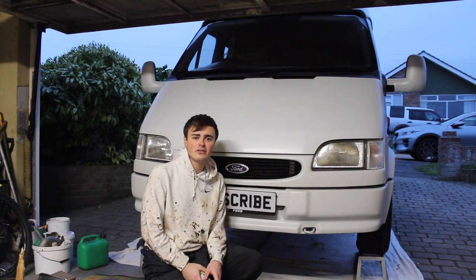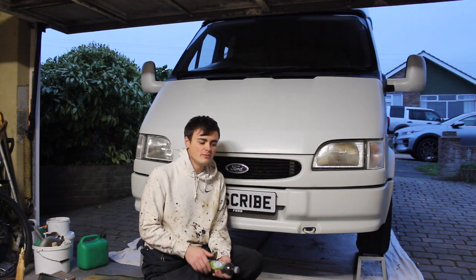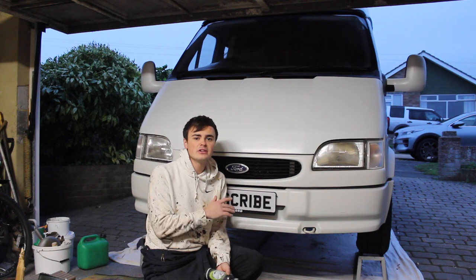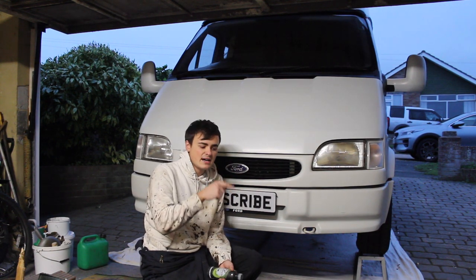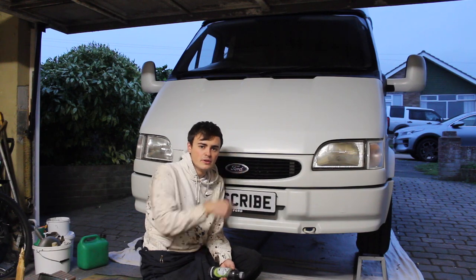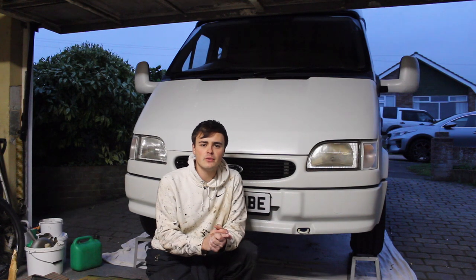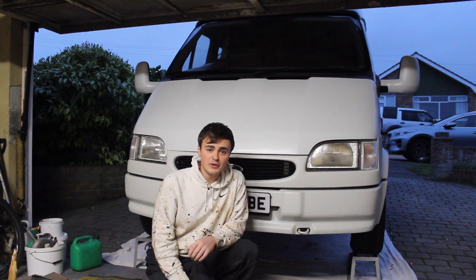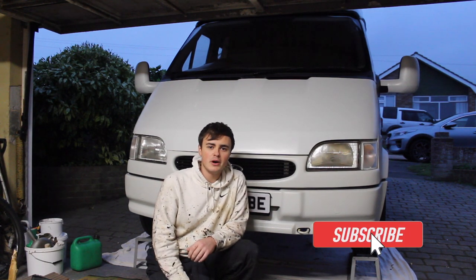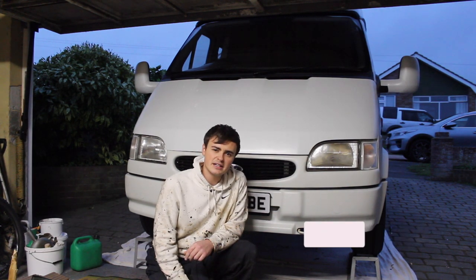It's getting dark already and I can't carry on filming because you can't see what I'm doing, but I think you get the gist of it — I'm just literally spraying wax oil into all the box section and inside the seals. I've got lots of little plugs I can take out and then just spray with my nozzle inside all the seals. I'd also like to say a massive thank you to everybody that's subscribed to my channel — I've got 400 subscribers now, which is just great. If you haven't already, please click that subscribe button and the little alarm bell so you get notifications when I post new videos. Thanks for watching and I'll see you next time.